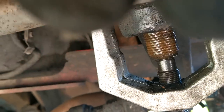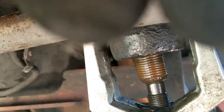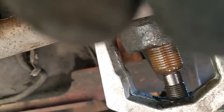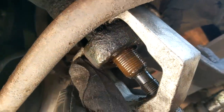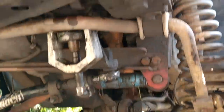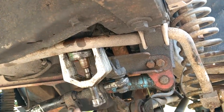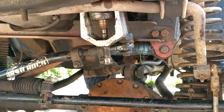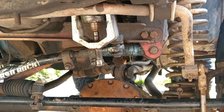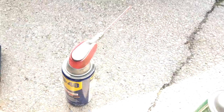All you want to do is beat it and the shock load should help free it up. You'll notice that because then this should be easier to tighten again. You get the idea — lube, maybe some heat, and some decent curse words in between. I've been beating on this end, beating on the other side, trying to beat everywhere. I've got maybe about an eighth of a turn out — she's pretty tight. I'm going to try and start the engine and maybe crank the wheel back and forth a little to see if the movement helps. Clean the area, WD-40, all that clean and lube — try and get a penetrant in as much as possible. Yeah, she's being a little bit of a bitch.